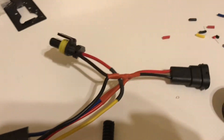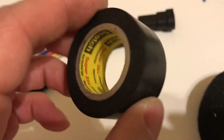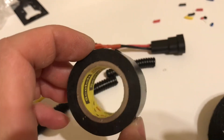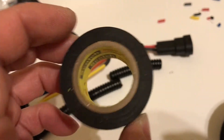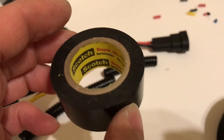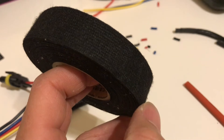Now that I've got everything soldered, heat shrinked, and looking good, I'm trying to make all my installs as OEM as possible. I'm using some wire loom on there, and I'm going to use some 3M 33 Plus electrical tape — this is probably one of the best electrical tapes you'll find. Don't use any cheap dollar store or Walmart stuff that dies and peels off. This is OEM quality, flexible, and it sticks because it's 3M. On top of that, I'm also going to use this fabric tape from TRS to make it look even more OEM.